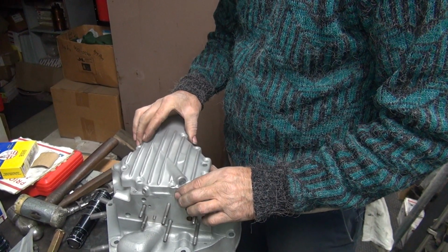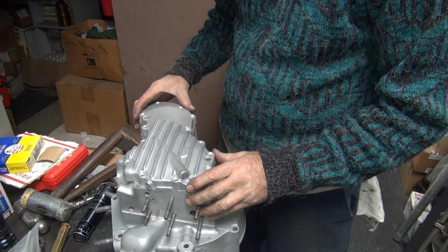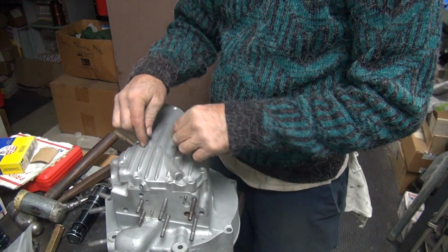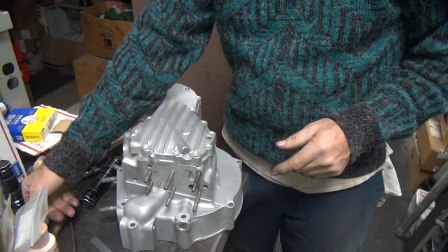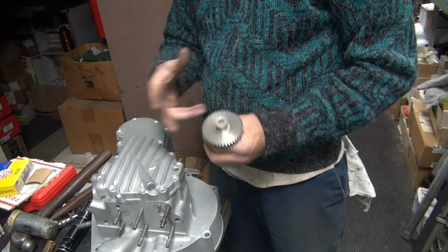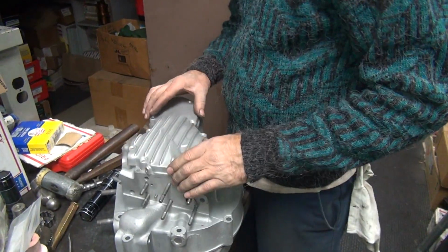Okay, so now we don't have to fight that. That's nice. The problem is the dowel pins are loose. It shouldn't. See how much that moves? That's how much all this moves here too, when we're trying to do our fitting. But also, the gears in here are moving also. That changes your backlash, the noises you get. But there's nothing really you can do about that.